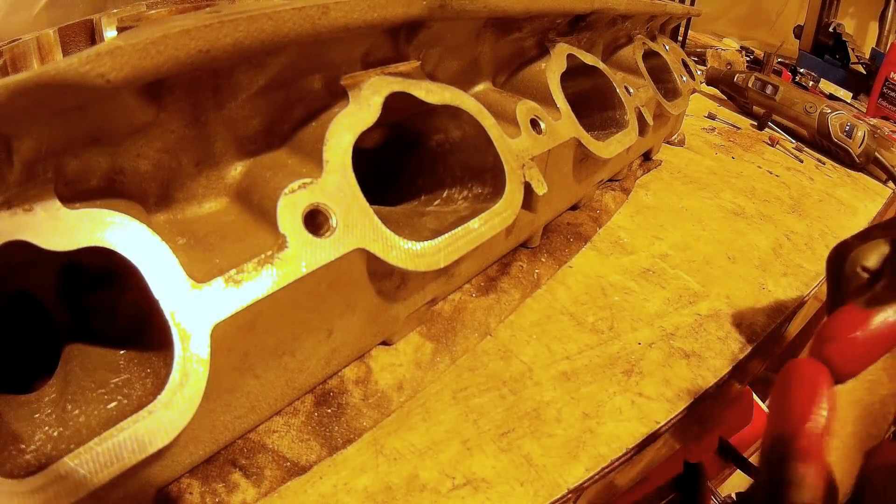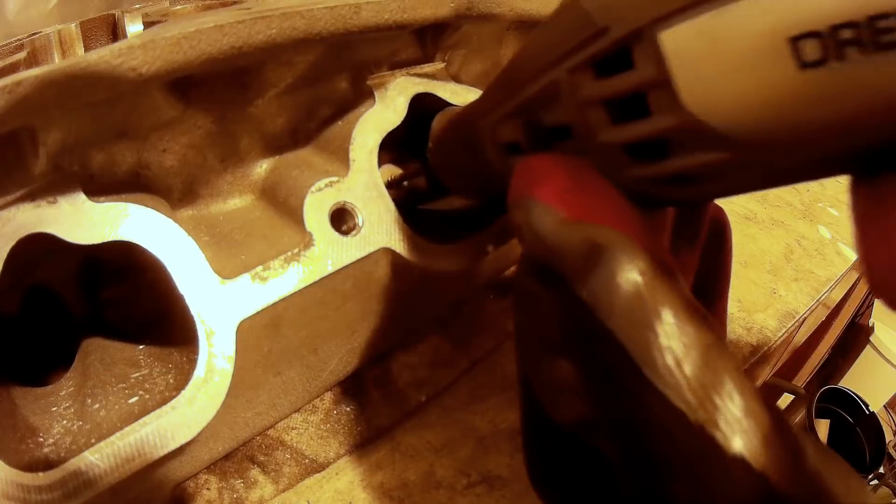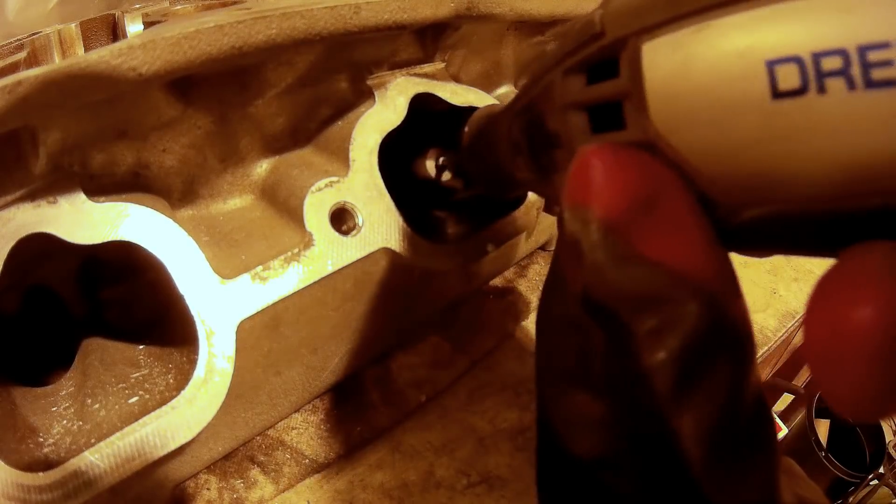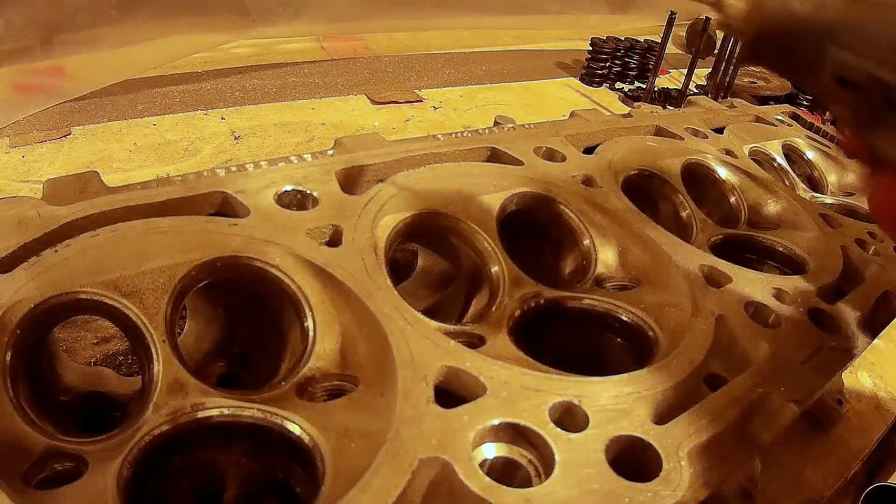After finishing with the cutting bit and removing all the casting marks, I used sandpaper to clean up all the rough edges it left. Since I didn't have a finer dremel sandpaper, I just used regular sandpaper by hand to get rid of all the deep scratches the coarse sandpaper leaves. After that I used the polishing bit with the Dremel to get a nice shiny finish. I did this on all sides — first one side, then flipped the head over for the top side, then did the intake runners from the other side. I covered about 90% of the intake runner with porting and polishing.